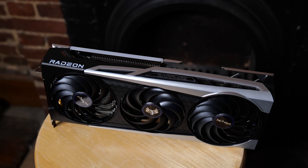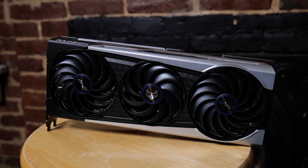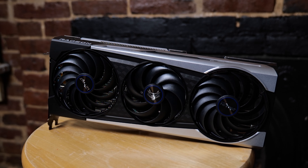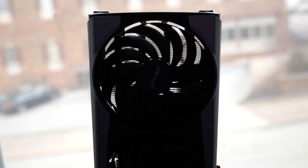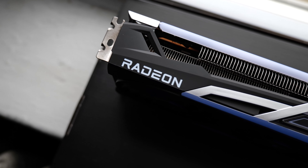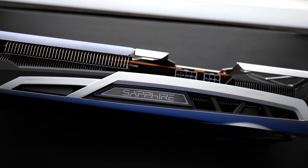The reference card was maybe a little bit weak in noise — when you max the fans out, it is pretty audible. When you max the fans out on the Sapphire Nitro Plus, it is barely audible, quite a bit quieter. It's got two very large fans and a smaller fan in the middle, with a ring on the side for more static pressure through the heat sink. It's a copper heat pipe design with full air pass-through at the end of the card, forcing hot air up and out of your system. It is definitely a much better cooling solution than the reference version, but it comes at the cost of being half an expansion slot thicker and having an extra fan.